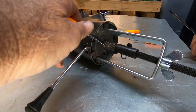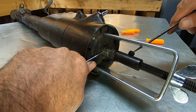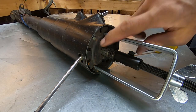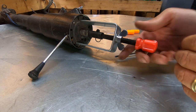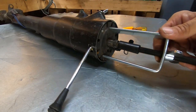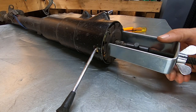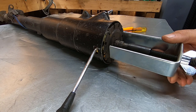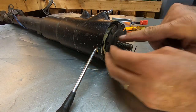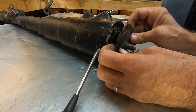Keep the lock ring to the side so it can't slide back on. Get around to the back side and take the pressure off the nut — everything comes out past where the lock ring was — then unscrew the tool. Now you can slide your locking plate off. That little button grabs this plate and that's what locks your steering. Pull your little lock ring off with it.